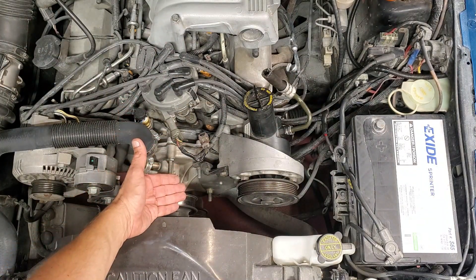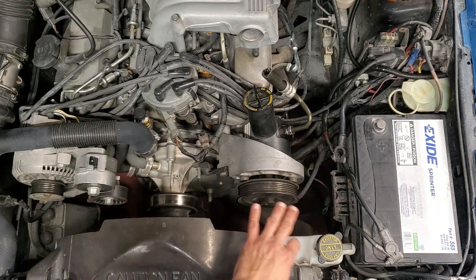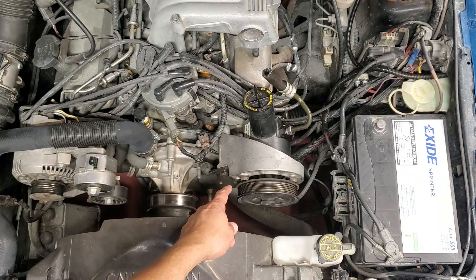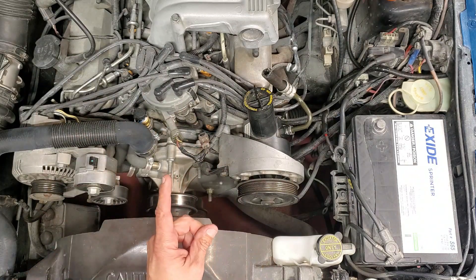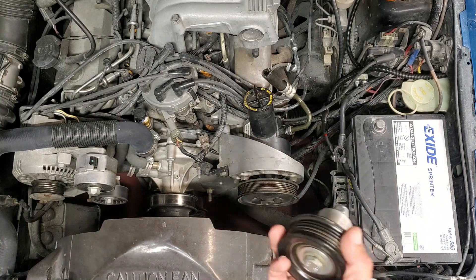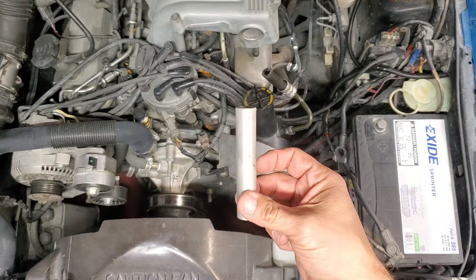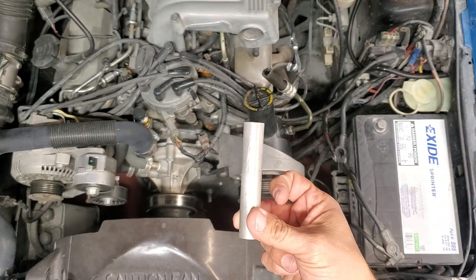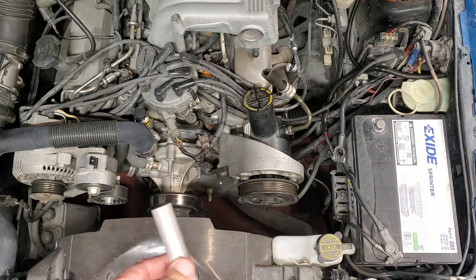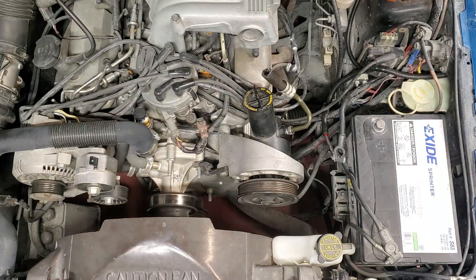This bracket came on the cars from the factory that did not have AC. Since we don't have AC or power steering over here, we need a pulley here for the belt. I do have a short belt that I bought years ago when I did this modification on the 8.9, and we'll be using that today. I also have these spacers — I can only find one, so I'm going to have to cut another one out of some stock.